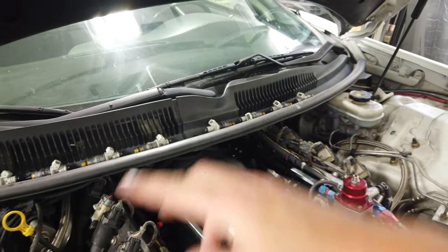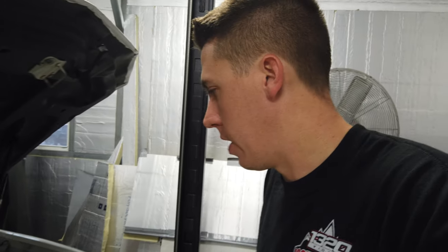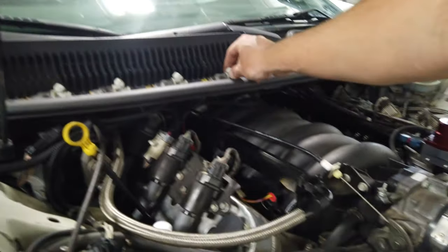So I'm gonna go ahead and take those inside, get those cleaned up, and then go ahead and pull the fuel filter in the back, do the oil change, and it's pretty easy maintenance. It's just to be sure that everything's good. Like I said, I've melted a piston from not having cleaned injectors, so I'm gonna go ahead and do that. And something I want to do this winter is change up the injectors.